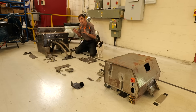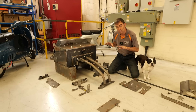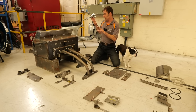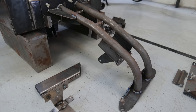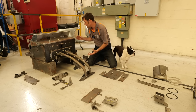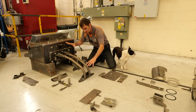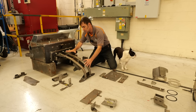I'm going to step back a bit — you've seen what the kit looks like when it's finished, but there's a lot of fabrication that goes into our 911 kits. I want to show you some of that on the floor here because this kit is about to go for powder coating. The rear battery box and motor cradle is what's here — this is where the engine and gearbox would normally sit on a 911, so it replaces that. It bolts in at the back and at the front. This cradle changes for the pre-73 911s; this is a G-body kit.